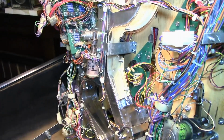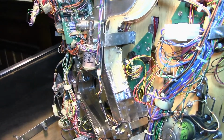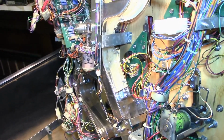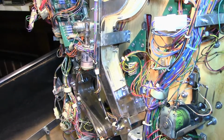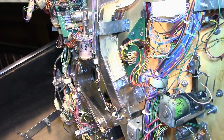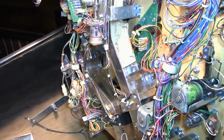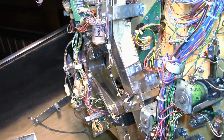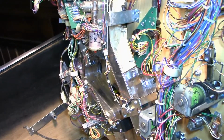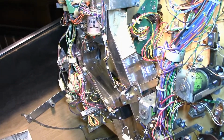Okay, well, almost made it home free on changing out the light bulbs that were blown out. So far, all of them that I've changed have been blown out, with the exception of two of the little twisty sockets in the circuit boards. It was either corroded in the socket where the bulb wasn't making a good connection, or there wasn't enough tension and it wasn't making contact on the wire that comes out of the bulb. So I had to sort of take a little screwdriver and bend the contacts back together.